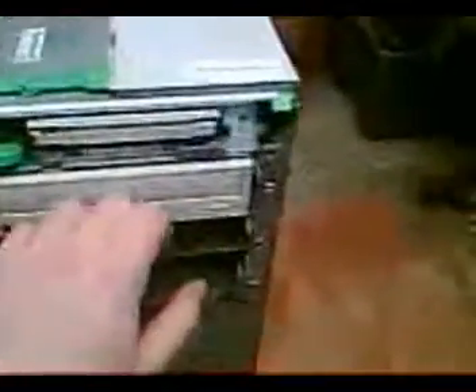That pushes back in, and if you replaced your CD-ROM with a DVD, then that pops in as well. Other things about it: changing the power unit. Looking at the back of the case, there's a release switch. Press that in and you simply take the whole power unit out. You can replace it with a power supply — this one seems to take a standard power supply.